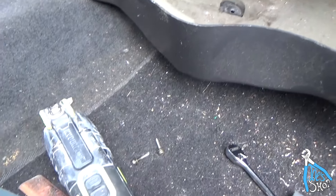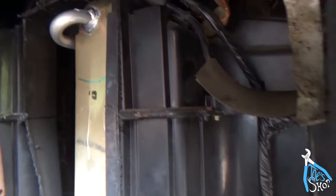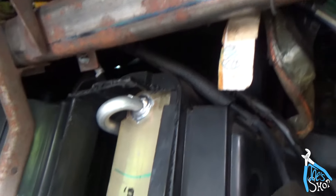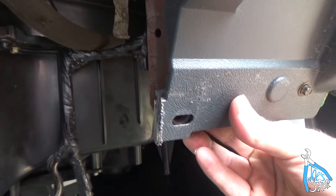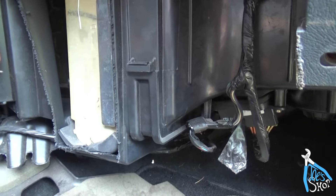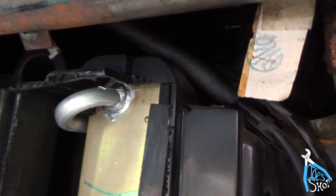I'm convinced one of these oscillating tools is probably the best way to do this. It's a pretty precise cut and you'd have a tough time with a cut-off wheel because of the diameter — you'd have a hard time getting past the center line of the radius and you'd start running into other dash parts. As long as you're not cutting any wires, who cares. You can see where I cut out this center section — I went all the way out to the edge on purpose because I didn't want something flapping in the breeze. This truck is perfectly silent for almost 20 years old, so I wanted to keep the interior noise level down. Looks like I nicked the old evaporator — good thing it's already junk.